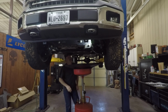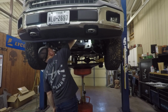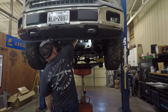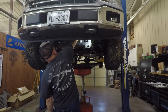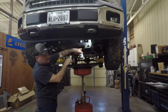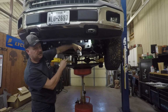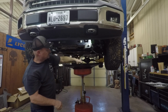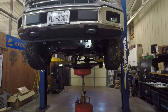So, pop that drain plug loose. This oil filter's about done draining, so I'm going to get it out of here. I can see the belt and hoses and things pretty good under here with the covers off. I just take the filter off and turn it straight up and down. You see the one from Ford looks different from the factory, but it's basically the same filter. It just has their Ford logo on the side instead of the Motorcraft emblem, and it's got the part number there too. Get a rag. I'm going to make a mess.